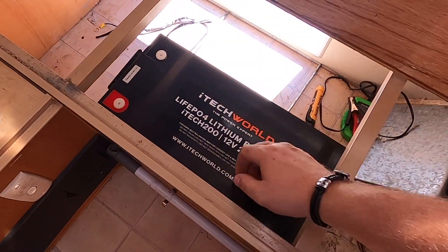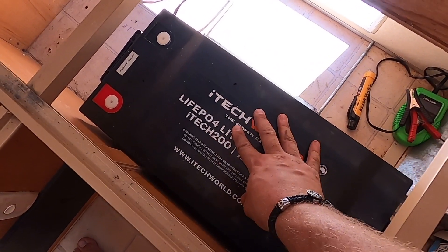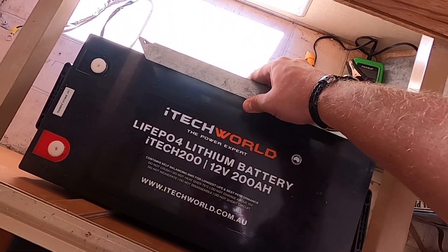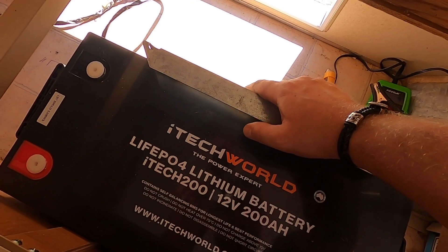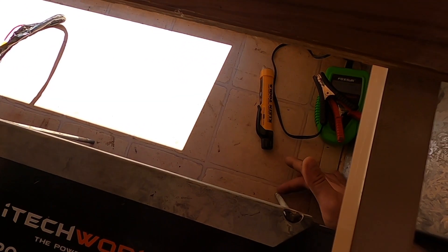You guys can see that the battery that's going in, the iTech World 200, is going to be bigger. It's physically bigger than the AGM, so we expected that. I'm going to have to put in a couple of new mounting holes. But the good news is the bracket that was holding our original battery is going to just slide down perfectly and clamp onto the side of the iTech World battery. So that's just something to consider if you are putting one of these in — you're probably going to have to modify your mountings a little bit. I'll just move the holes where this goes through the floor, put a couple more holes in, and bolt it back up. I'll get it as close as I can to the original two mounting holes for this clamp.